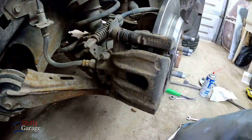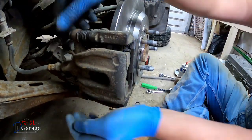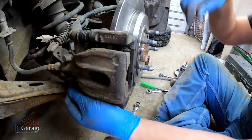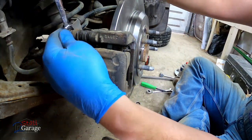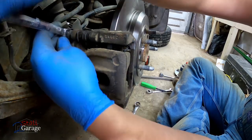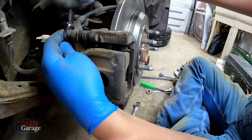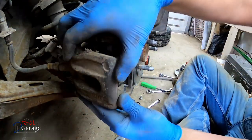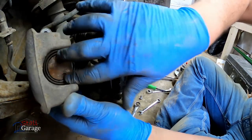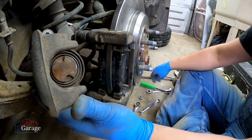Oh yes, one thing I forgot. And I think that's what I'm running into here. Those notches, you actually have to make sure that they line up with this little notch on the brake pad. I bet that's why I'm not going all the way in on the bottom. Make a big difference on your install. And these are on the side like this, and I need to turn them like that.